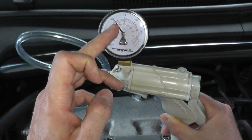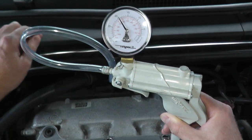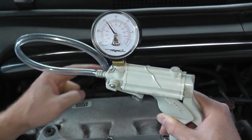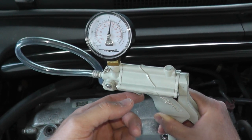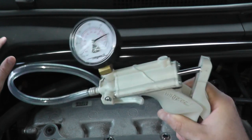If the needle moves very, very slowly, chances are you just have a small leak here or at the other end. But if the needle is not straight, then you certainly have a leak in either the rubber hosing or the engine mount. I'll show you how you can diagnose where the problem is. Press on the bottom to release — and one more time.